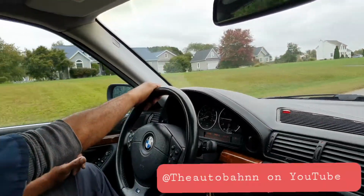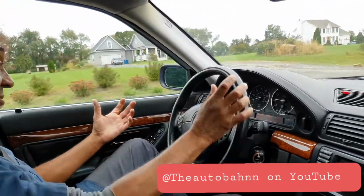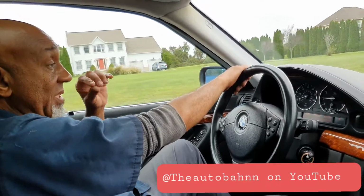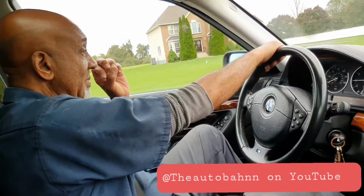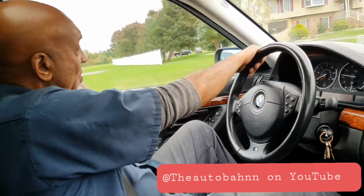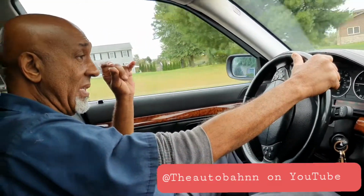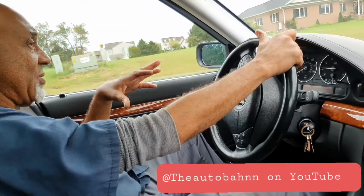And I started to tweak stuff on it. Like, I got the stabilizer links with grease nipples on them so I can grease them, stuff like that. Wow, so all the weak points addressed. Yeah, all the weak points addressed. The biggest weak points I had on this car were the cooling system and the oil leaks. And I think once I took off all the oil lines and got them redone with the silicone lines from that company, that took care of that. And on the cooling system, once I put in a thermostat that opens sooner, making the car run cooler, I think I just tackled the two most vulnerable weak points.